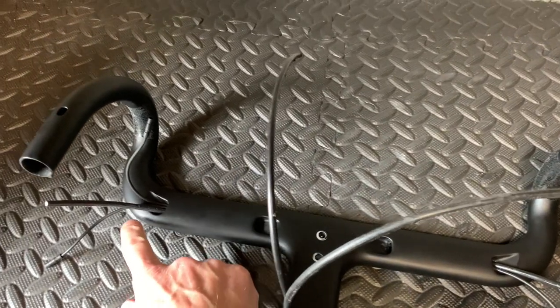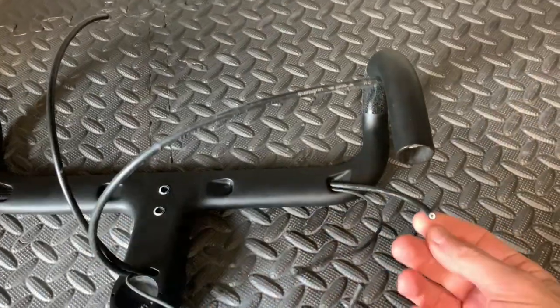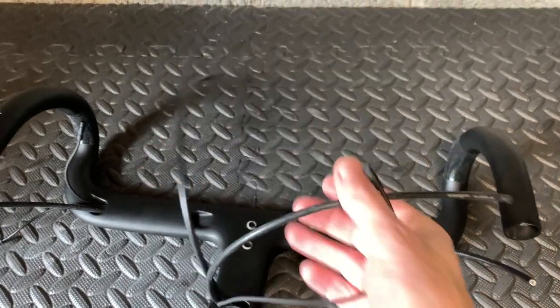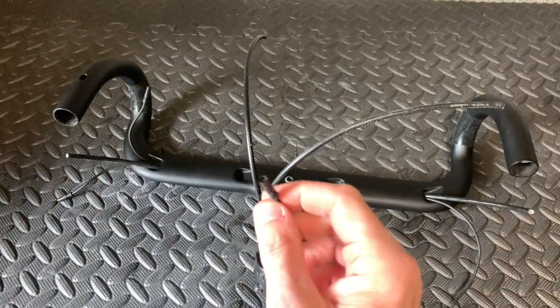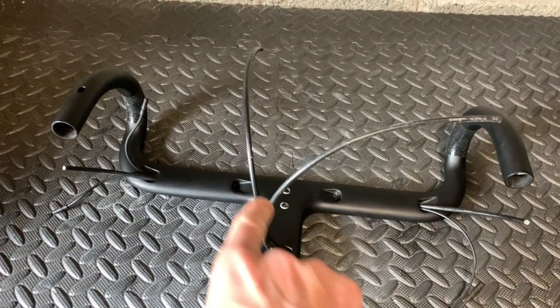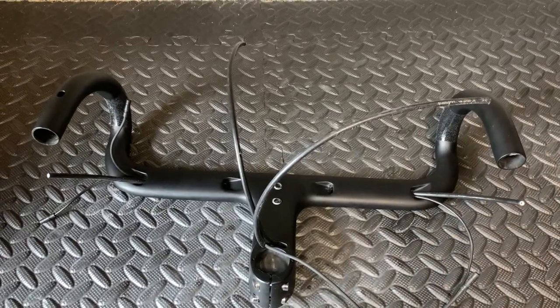I've been practicing threading these. As you can see, I've got my two Di2 wires here, hydraulic brake here, this side I've got one Di2 and one hydraulic brake. Coming out of the stem I've got one Di2 and both the hydraulic cables. This one attaches to this side and one just goes all the way through, allowing me to attach it to the charging port which is in my frame. That powers up to the shifter, and that shifter just joins to the other shifter. So I've daisy-chained them together.